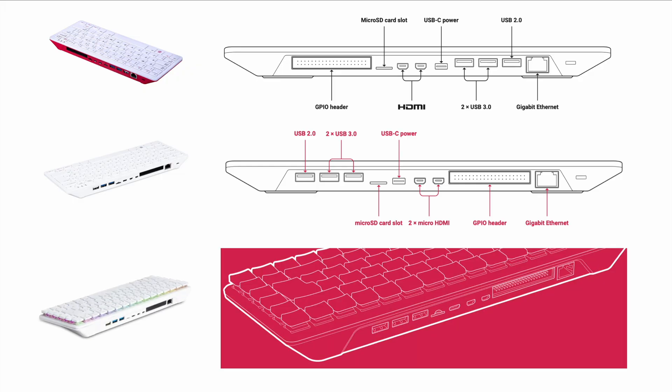Finally arriving at the 500+ model. Unfortunately there's not yet an official pinout in the datasheet, but from the drawing on the back, nothing changed here really. It's still the same Raspberry Pi 5 inside the keyboard, not a new version of the Pi. That's why it's still called the 500, just with a plus to indicate a few extra features. Interestingly, they kept the microSD slot even though you now have SSD capabilities — so you still have that option and don't need to go with the big SSD, or you could split between operating system and storage.